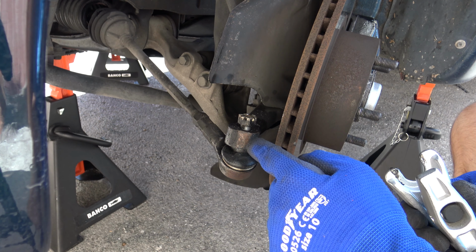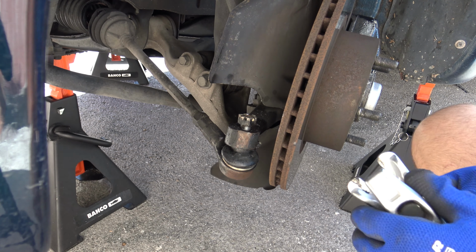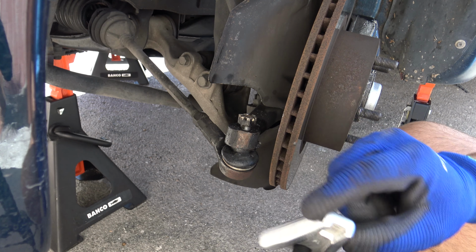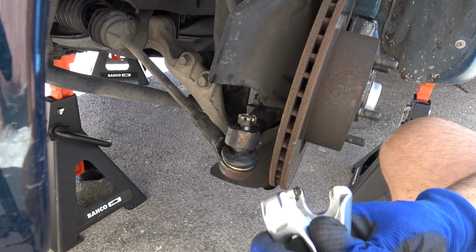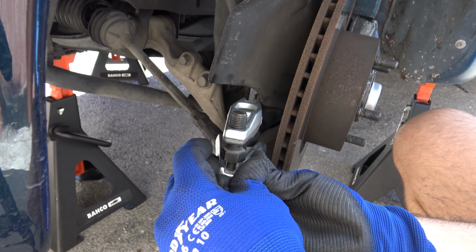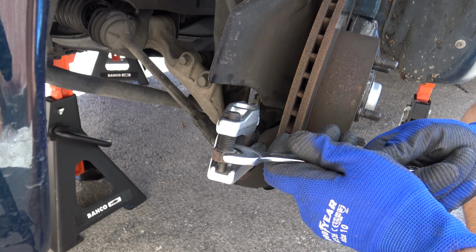Come on guys, for most of us the car is our best friend. Don't hammer or burn it. Spend a few bucks and get a suitable tool. Check always the description for info and updates. The tool I use is similar to others. Position the forks on the arm and then screwing the bolt will push the tie rod out of the knuckle.